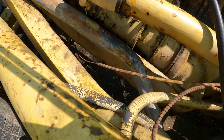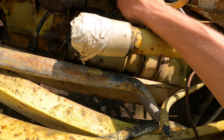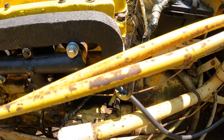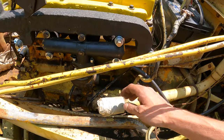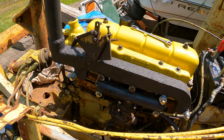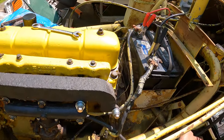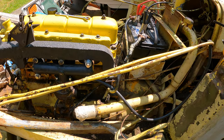That's really nice too. So I guess while we have the carb up, we'll hook that up and that goes right in here into that choke right here. So then we can actually choke it. Probably drip a little bit of lube in there real quick. All right, so we need this to come off, 9/16 on the carb, and put that choke on. And that'll be ready.